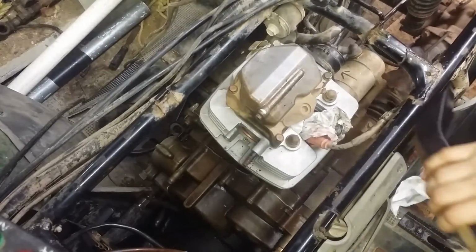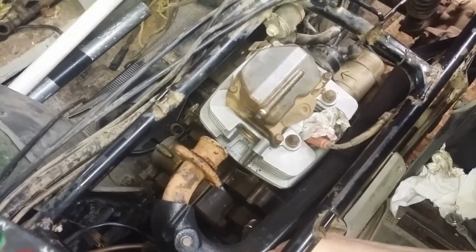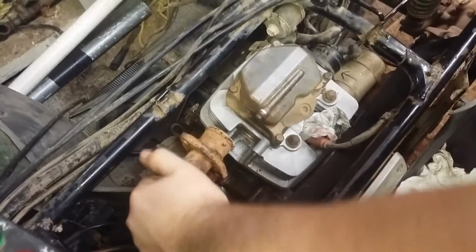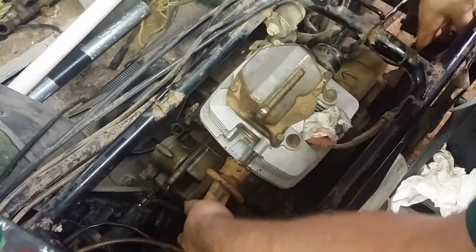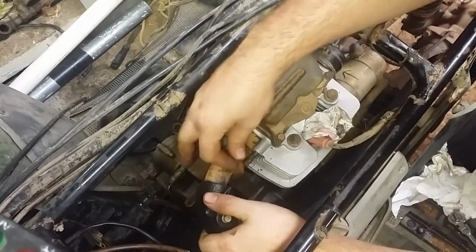Now that the heat shield is on, I can work on fishing it back through. So please excuse the clicking once again. Alrighty then. Header once again. I'm going to fight it through here, which is why they have this fender over here unfastened. Get through that space. Well, maybe not. There it goes. It's got to fit underneath this fender brace here. There it is. Then we go up to our gasket, which is already mostly flattened, which is a good thing.